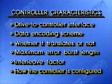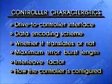Back in 1983, IBM offered a 10 megabyte hard disk subsystem for its new XT. As there weren't too many other hard disks around at the time, the hard disk controller was pretty much hardwired to only work with a 10 megabyte hard disk. A bit later, IBM offered a choice of hard disks, either 10 or 20 megabytes. To accommodate this, they used a controller from Xebec that could support either size. In fact, it could support 4 hard disks, 2 varieties of 10 meg, a variety of 20 meg, and a 5 megger. You indicate to the controller which drive you had by moving a jumper on the controller board.